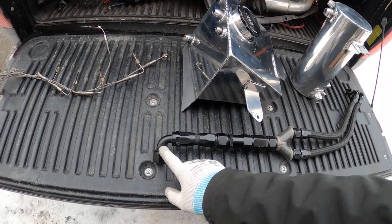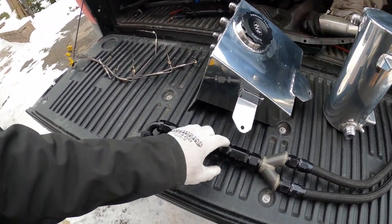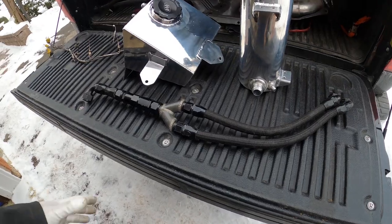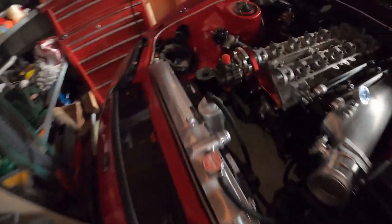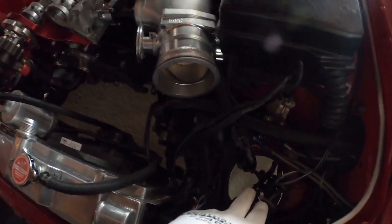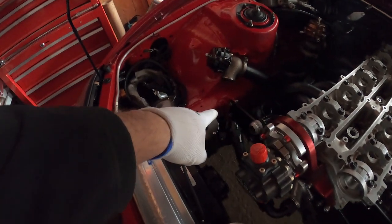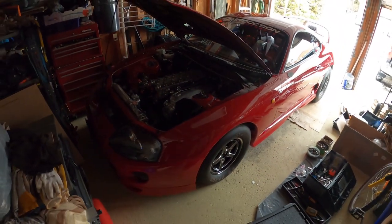The outlet from the pump is going to be AN-12, then it goes to a one-way check valve. This is very important when you have a mechanical fuel pump sitting higher than the tank — when you shut off the engine, this valve closes and the fuel doesn't back out, so when you start the car again you don't have any issues. The fuel pump here runs a dash-16 to the tank, and the outlet feeds the rail. We'll also be doing the water pump fitting today.